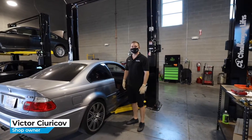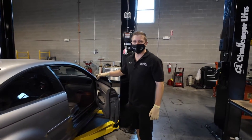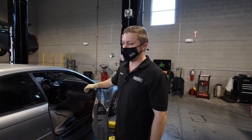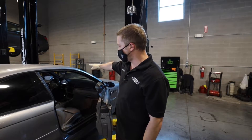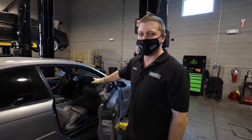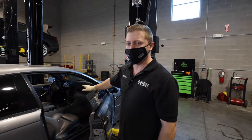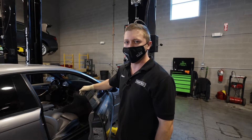Welcome to Workstad, a BMW and Rolls-Royce automotive shop. Today we're going to talk about SMG to manual conversion. A lot of people have issues with cruise control or PDC. PDC is fairly simple — one wire going from the cluster to the fuse box. Cruise control is a little more tricky, and forums don't really have a proper answer. It's actually pretty simple — one wiring diagram. Let's lift up the car, look underneath, and I'll show you which connector we're going to work with.